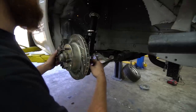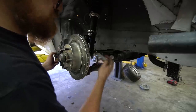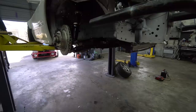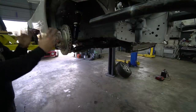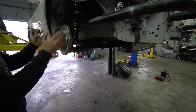I do need to center the rack though, because if it's offset one way or the other, we'll have more angle on one side than the other. I'm going to take this off, get the other side thrown on, and then we'll center the rack. I just wanted to make sure it still fit with the rotor — that was the problem with the other knuckles. We've got the rack centered, tie rods in and adjusted correctly. If the wheels are roughly straight, we'll have to actually align it, but baseline — now we can put the wheel on and see what kind of angle we have.